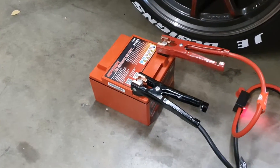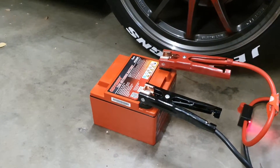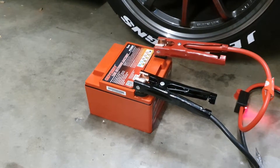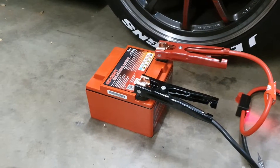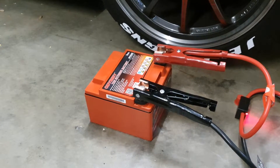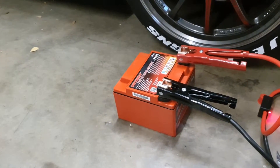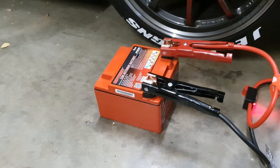If you get to the point where your battery goes beneath 11 volts, into the 10 volt range, what you'll then find is if you try to put a charger to your battery, it more than likely will result in the charger not registering that a battery is there, and so therefore won't give any charge at all. Or you might find that it tries to give a charge and then the battery just doesn't accept it and doesn't charge up.